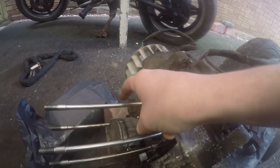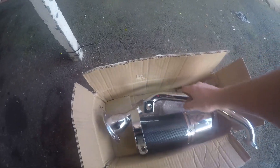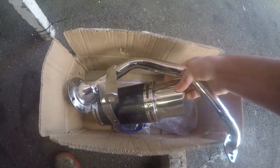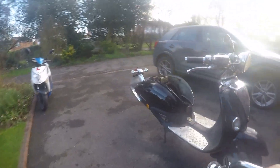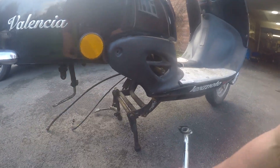There has been some confusion as to how much oil to put in it, and that has resulted in - if we have a look over here - the piston is absolutely minced. It wasn't seized but that obviously ain't gonna work. So what we've got to do today is rebuild the top end of the engine, put the engine back on the bike, and he's also got an aftermarket exhaust for it because the exhaust that was on it was pretty rotten.